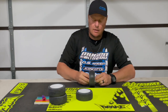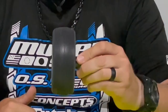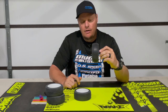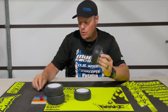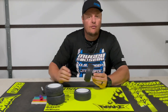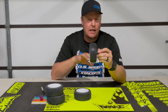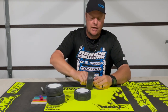We'll check these last two real quick. You can see my fingers are just shaking just a little bit — it's not bad. You could race with these tires no problem. But the main reason for wanting to do this is it's going to give the car a little bit smoother, more consistent acceleration. It's also going to make the suspension components last a little bit longer, because if you have all four of those tires shaking and vibrating, it's shaking and vibrating the whole car. Just a really quick little piece of putty and that vibration and shake has gone away.